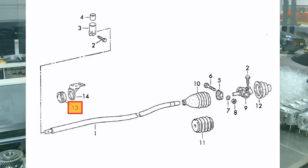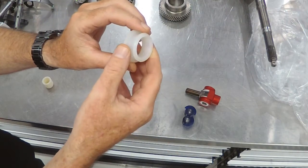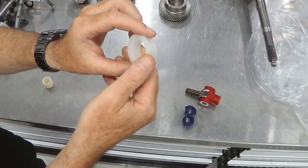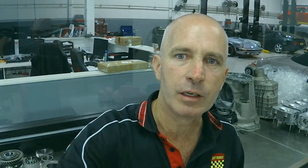That shift rod goes through a support bush — we're talking movement along the length of the car — and it goes through this tunnel rod support bush. The shifter rod is located within this, and again, wear in this bush introduces slop and imprecision into the shifting mechanism.